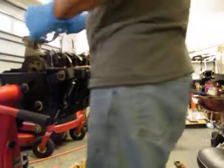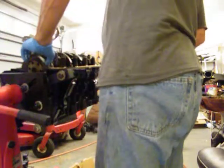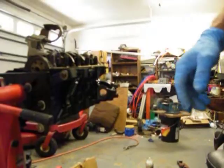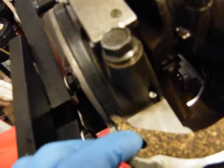I'm gonna cut those little tabs up there and just put RTV in there. What I was saying is I'll take and cut that right there, and then cut that right there — get the line holes lined up on it. You'll see how much you have to cut. I'll cut it back to right there and cover it with some RTV, and same here — these tabs have to be cut so that it seals perfectly. When I get this glued to the pan, I'll run RTV around this right here too, all around it.